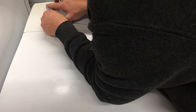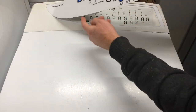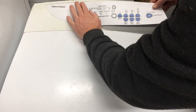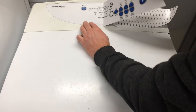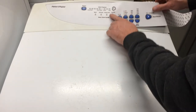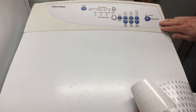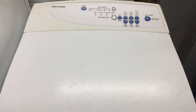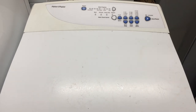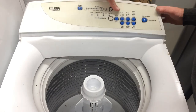Make sure it's not going hard into that corner — just sitting about a millimeter out. Hold the peeled part away so it doesn't grab prematurely. I'm already a little too high so I'm using the top edge to get it straight. I've got a small ripple here but it's a small enough ripple that I can work it out. There we go — it's not quite perfect like a machine would put it on, but it looks a lot nicer than it did, and we're not going to have dirt and debris getting into those buttons and onto that control board doing further damage. Thanks for watching — if you've got any questions feel free to ask down below in the comments. I check every couple of days and I'll answer if there's any way I can help. Cheers.